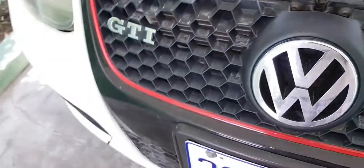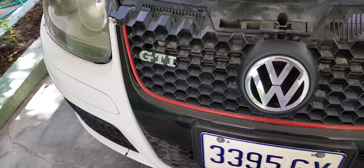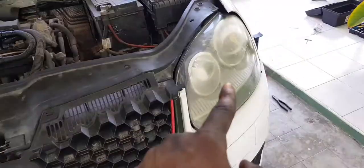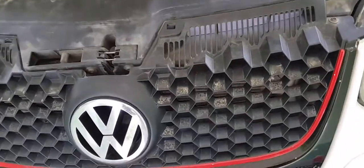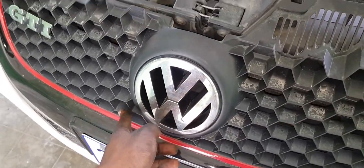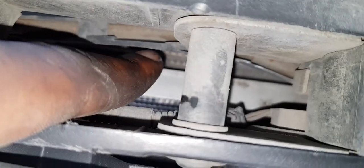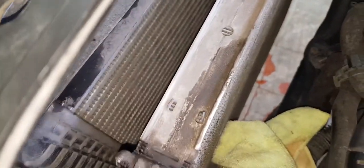Normally the factory procedure involves pulling the front wheel, front bumper, and headlights — both right and left — and pulling this whole thing off as a sandwich. For the GTI, because it's turbocharged and intercooled, you have the AC condenser up front, then the intercooler behind it, then the radiator, then the radiator fans. A normal FSI engine would have just the radiator in the middle with the AC condenser up front.